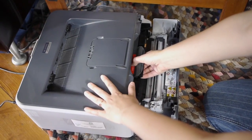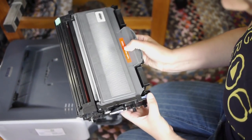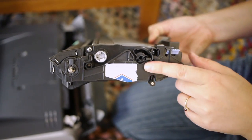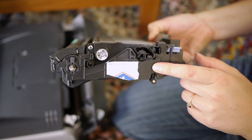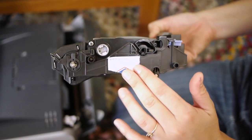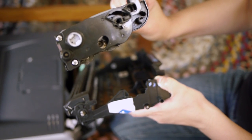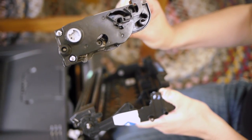You just open the front, pull the cartridge out, and take it out of the black container. On the Brother laser printer there are two sensors on either side that tell the printer the toner is low. Something a lot of people online have suggested to keep your toner going is to cover up the sensors. I just use an opaque label to cover up the sensor. Once you take this off the holder, you can see the sensor down in the middle — that's what we're trying to cover up to extend our toner life.